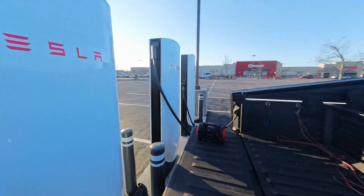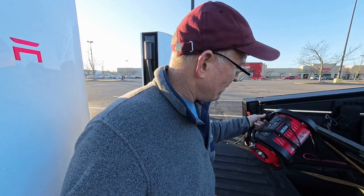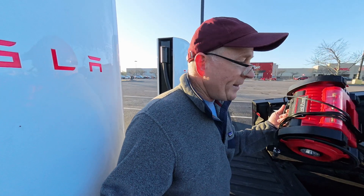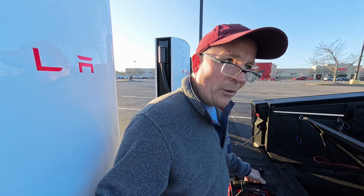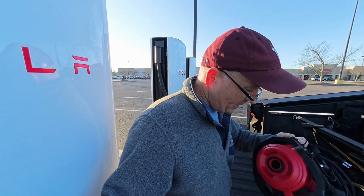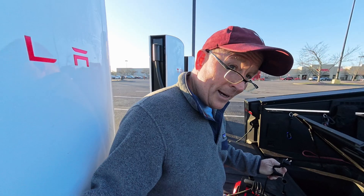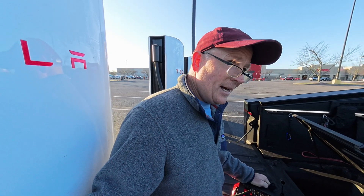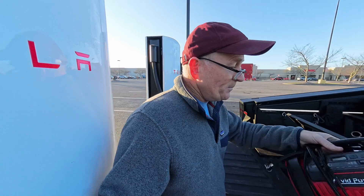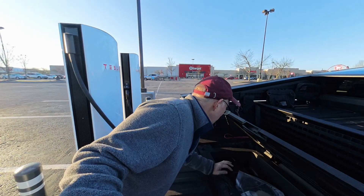For pumping up the mattress, I keep one of these air pumps. It's also important as a Cybertruck owner since there's no spare tire — one of these pumps will handle a slow leak and get you to safety. The one critical thing: you need to get a 110-volt pump. Most air pumps on the market, including some Tesla ones, use the 12-volt outlet for the Model 3, Y, and X. The Cybertruck has a 110-volt outlet, so make sure you find a 110V pump. I got this Avid Power one off Amazon and it fits right down in there.